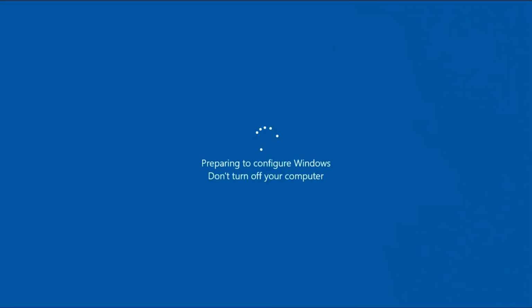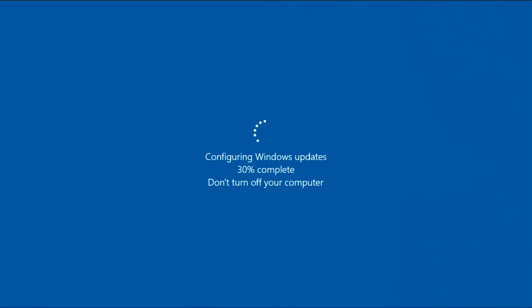So I do realise that there are needs and musts, and people will swap and change different configurations. The way everybody uses the system is different. I do realise that, so I'm not saying this is the only way. I'm just advising that where possible, if you inherit a PC that has a mechanical drive with your OS on it, go and get yourself an SSD, or if your board supports an M.2 drive, maybe clone it over to that other media and use that as your boot drive, and then use your mechanical drive for storage. Especially when you want to store photos or everything, just use it for storage.